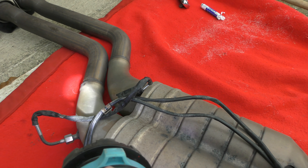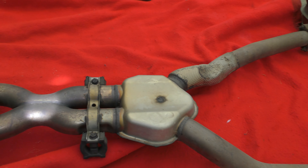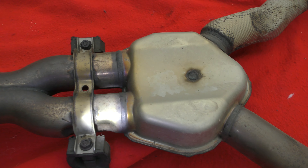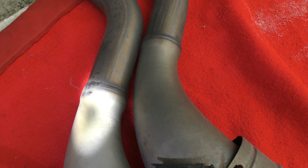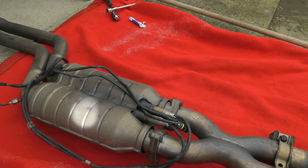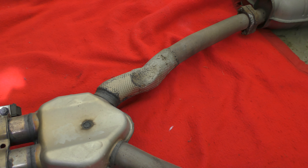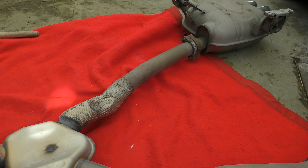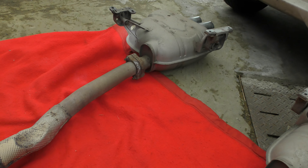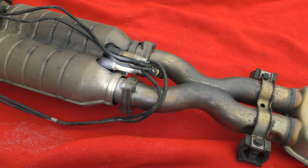There's another sensor around the other side and there are two more sensors in the exhaust headers. Two catalytic converters and the mufflers. It's the original system, 17 years old now. It's impressive in that it's all stainless steel as far as I can see — stainless steel will still rust in the end, everything rusts. Good for 17 years though. You can see it's starting to come apart at the welds, which is usually where they go, and there are a few blows and holes in it. I still haven't decided what I'm going to do with it — the whole exhaust is too quiet for me. A car like this needs to be louder. Do I keep this section and buy an aftermarket rear section, or keep the rear section and buy an aftermarket front section without catalytic converters? I don't know — let me know your feedback.